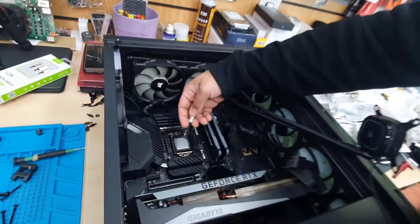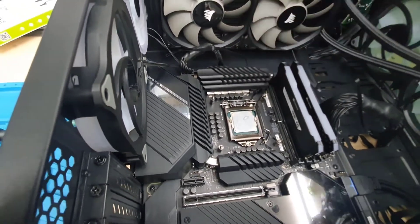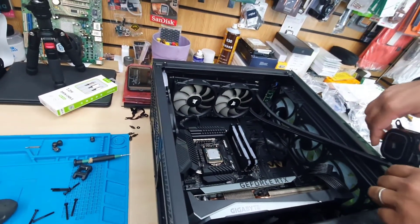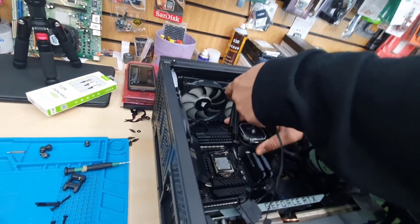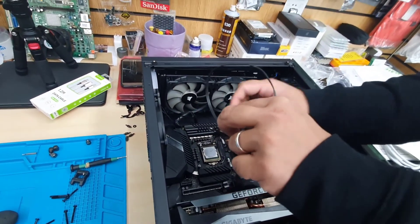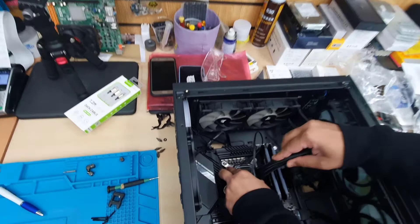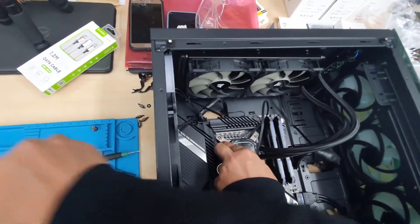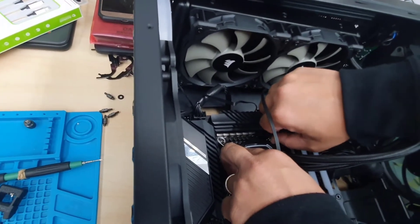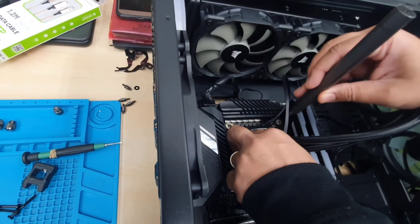Now is the time for a little bit of thermal pasting. From my experience, the pre-installed thermal paste is not enough — after six or eight months it can dry out. So I added some to the center point so it would spread out. Now we're going to add the pump. There are two cables: one goes to the CPU fan connector and another goes to the RGB power. Now we're going to add the four screws on the head. The best way is to do it in a cross pattern — don't tighten one fully after another; do it diagonally.